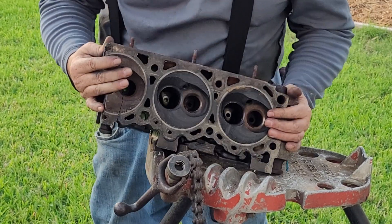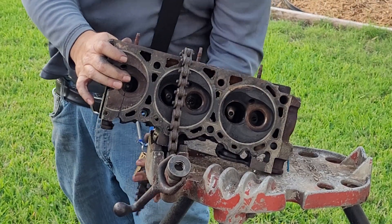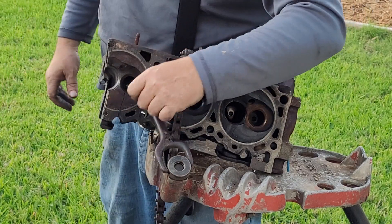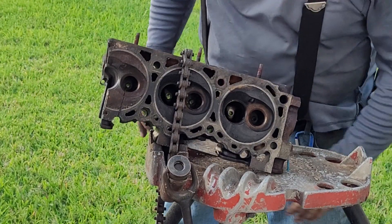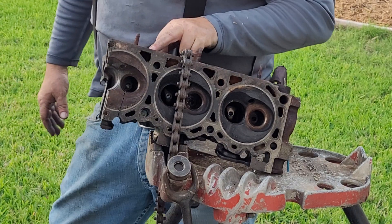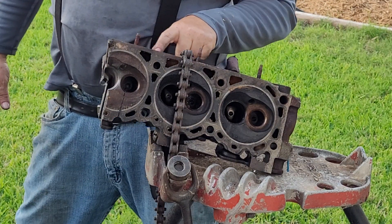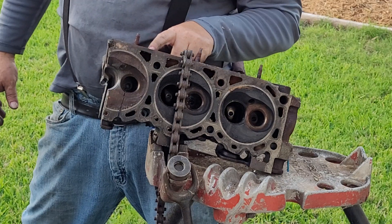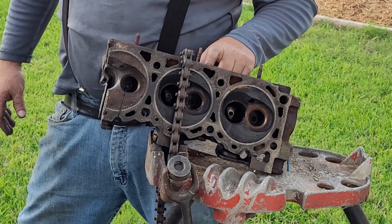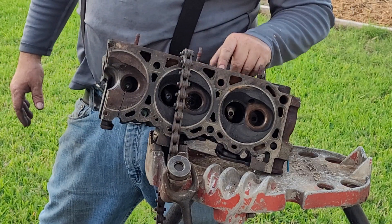Notice I'm doing this on the grass and not on the driveway — because that much cast iron dust will have a huge rust stain on the driveway, and the driveway looks bad enough the way it is. Interesting how they did the exhaust port on this. This is a later model — the older models had much bigger exhaust ports. You can see the manifold interface is absolutely huge compared to the exhaust port — way too big for an engine this big. That's why they shrunk the port, but they left the exhaust manifold the same size, so they have huge anti-reversion.